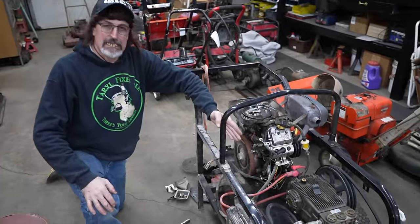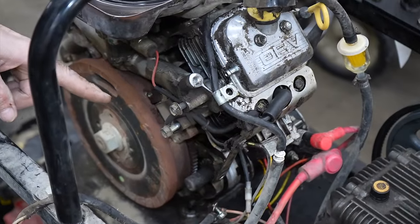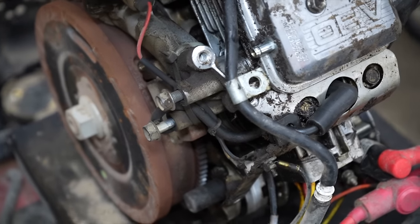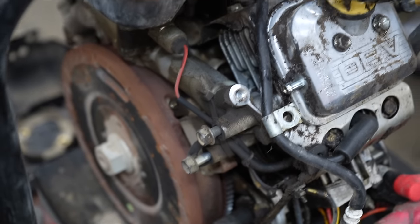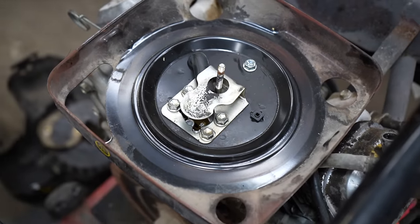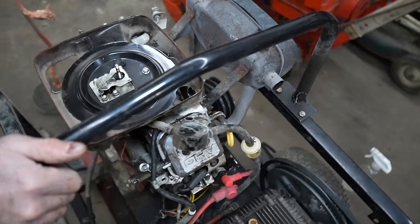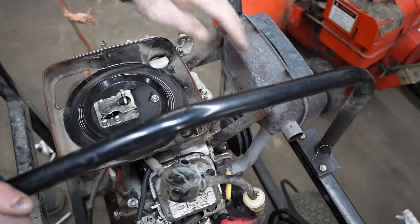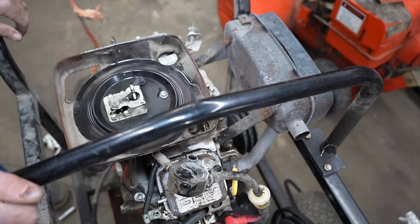Well, looky here. Pulled off that blower shroud, and that's just how them bolts were. Backed out like that. So it's sucking air. So that's why it was getting better. Before I pulled that screw out of there, that thing was ice cold. I could put my hand on it, it wouldn't even burn them. And then the second time after we put the screw out and started it, it was getting warmer to the point where you couldn't put your hand on it, but yet it wasn't as hot as this side. So it's sucking air